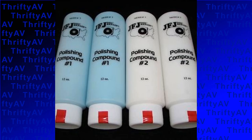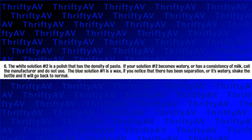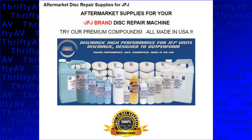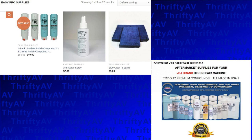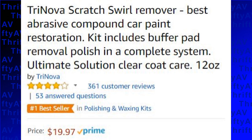Both the white and blue polish can separate over time and when exposed to extreme temperatures. With the blue polish, you can shake it up and still use it, but remixing does not fix the white polish. Once the white polish separates, it stays separated and should be replaced — I avoid buying the white solution in bulk because of this. The instructions suggest only using JFJ polish and pads, but I found aftermarket products that work with the JFJ polisher from Disc Magic. I've provided links to both JFJ and Disc Magic in the description. I've read that some folks have used car polish and wax in these machines, but I do not recommend this, as it's best to use polish designed for optical disc repair, and car polish can often be as expensive as these CD solutions.